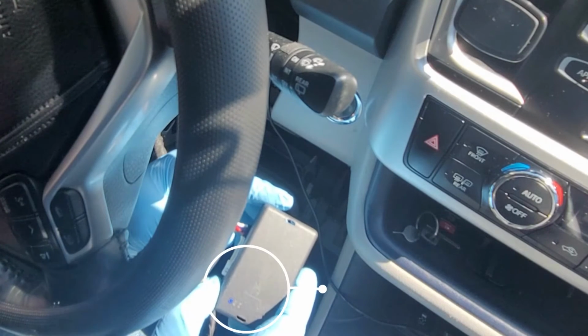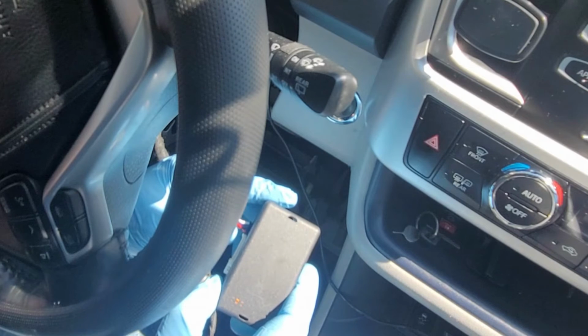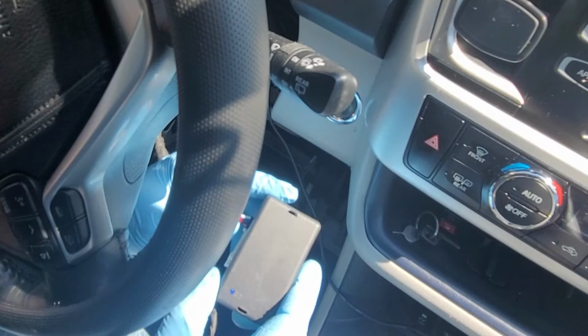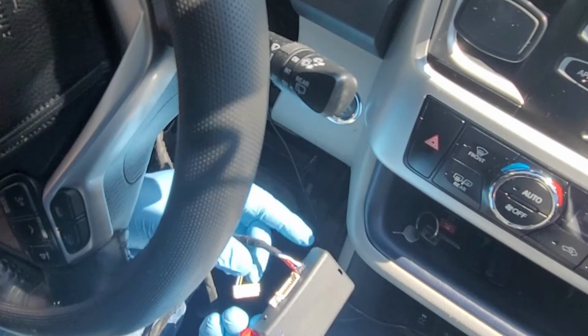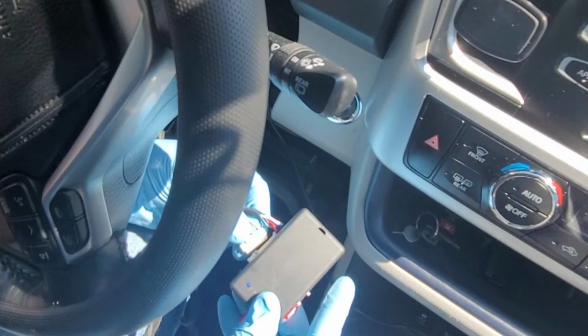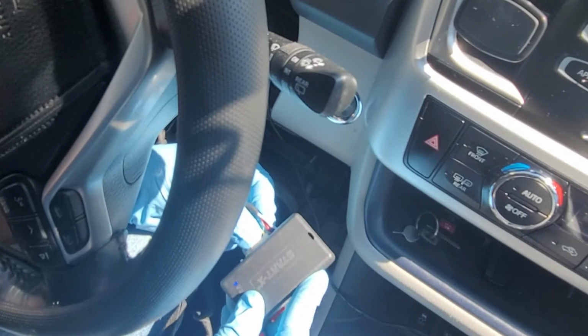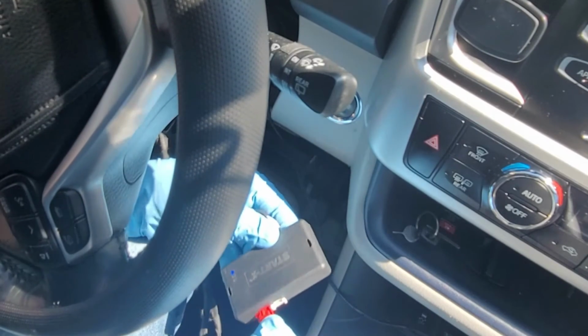The blue LED indicator will light up, then other color LED lights will alternate. When the LED light switches back to the blue LED, release the programming button. The blue LED light should stay on. If not, unplug and restart the process. If the blue LED stays on, insert the other 3 remaining connectors.